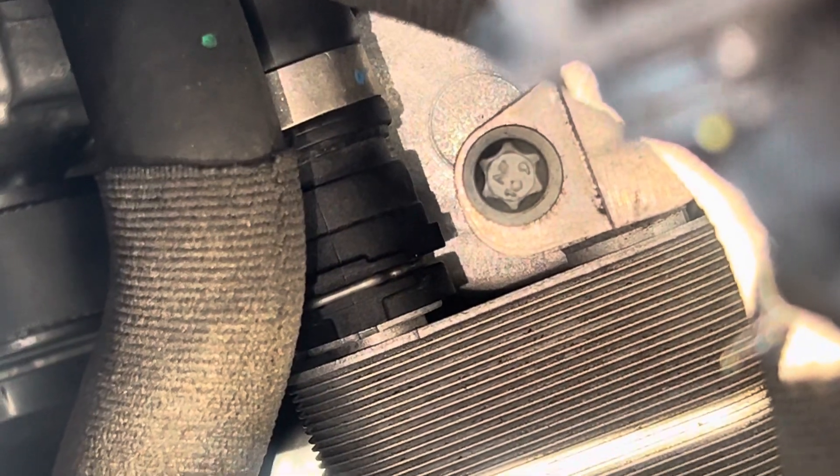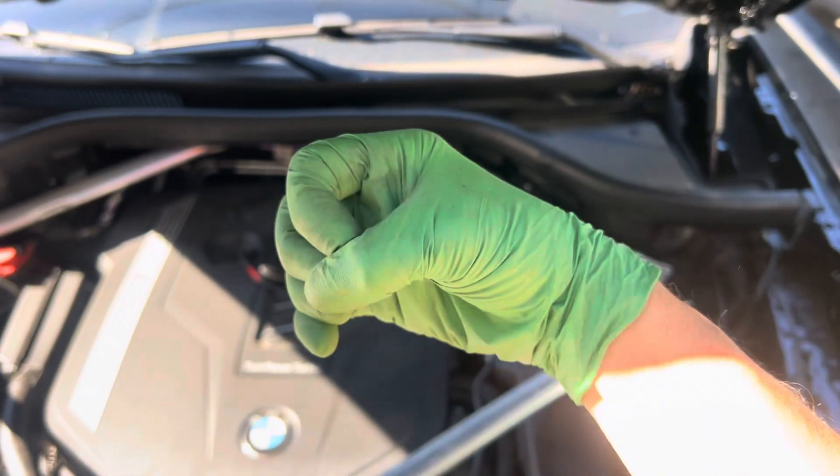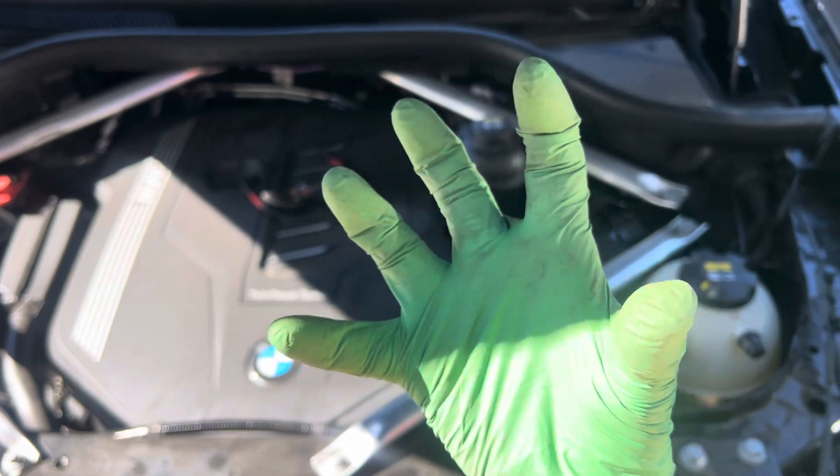Do you see the pin wire connector, the spring wire clamp, and the glycol coolant hose? That silver band going into the plate heat exchanger — and you can see some refrigerant lines. That little bendy 180-degree line — that's refrigerant. There's also an expansion valve on that assembly. It's a whole assembly: plate heat exchanger, receiver dryer, and expansion valve all in one.